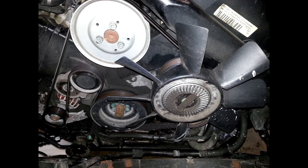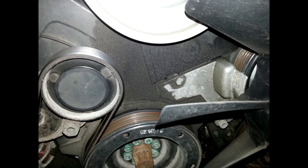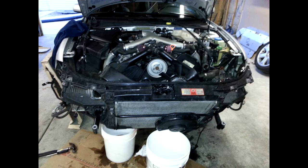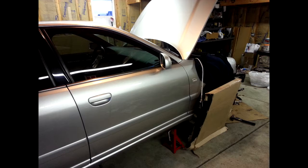What I proceeded to do then was fold the whole front end of the radiator assembly down so I could see further into the engine and lower down on the front of the block. Because this is a Tiptronic car, there are transmission lines that feed into the radiator, so I was unable to completely remove the whole front radiator assembly. I worked around it by basically folding the whole front radiator down onto a couple of buckets.